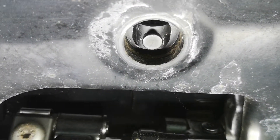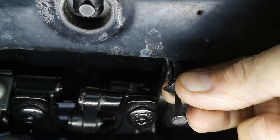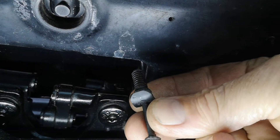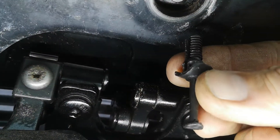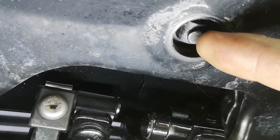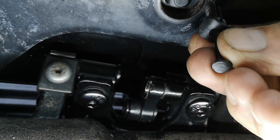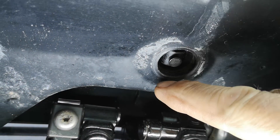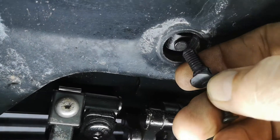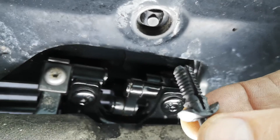So these clips, which are the middle two fixings - what you need to do is extract the centre pin. Get something behind that and pull the pin forward. And then maybe a couple of screwdrivers, one above and one below, unless you've got a hook that you can get in there to withdraw that ribbed plug.